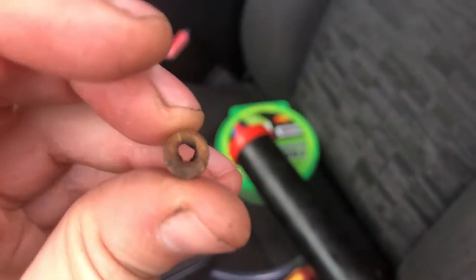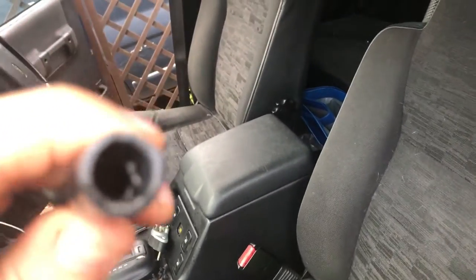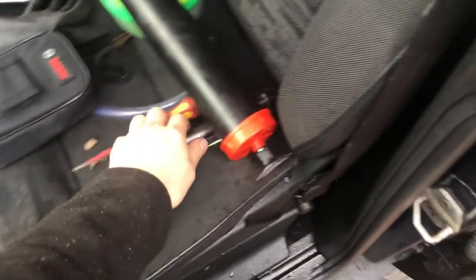A little bit of dowel is in it as a joining piece, because where the drain thing on the sunroof tray snapped off, it's also snapped off inside — all the way along. I'll heat this off, take the plastic out inside, and hopefully the pipe is long enough. I put a load of water down there and it's draining freely, so we know the pipe's not a problem.